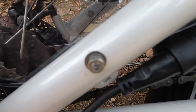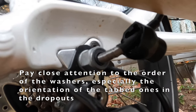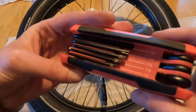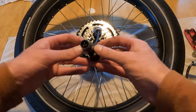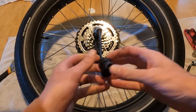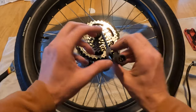The first step is to remove the rear wheel and disconnect the motor cable and any zip ties holding the cable in place. Remove the torque arm and axle nuts with an 18mm wrench. As far as tools, you will need a freewheel removal tool — we are using the one from Bolton E-Bikes, which is made to fit over the motor cable and nut to reach that freewheel. You will also need a T20 security torx bit with a hole in the center to match the security pin in the screws. Be sure you use a high quality hardened one — one that is made for impact wrenches is preferred because these bolts are tight. Ultima provided a Craftsman one, which did the trick, but it still took some work.